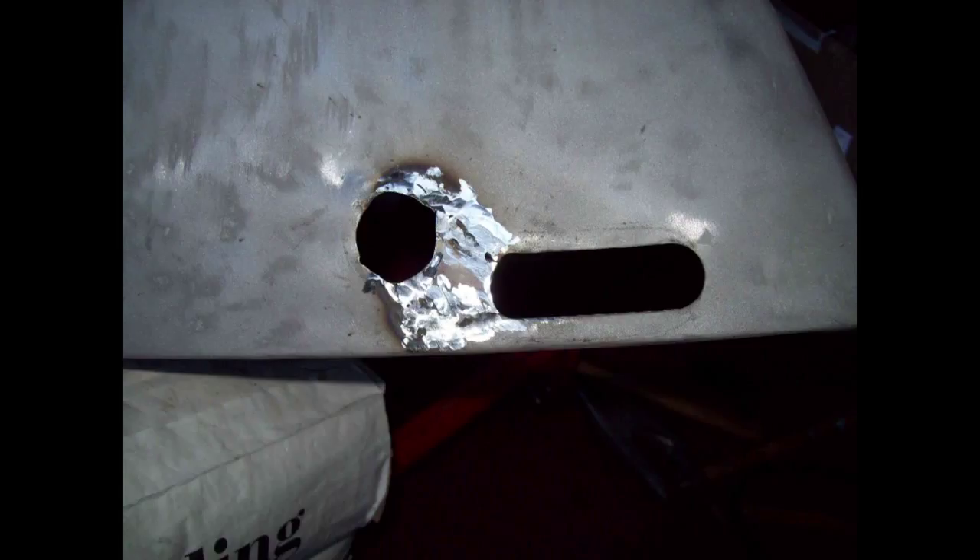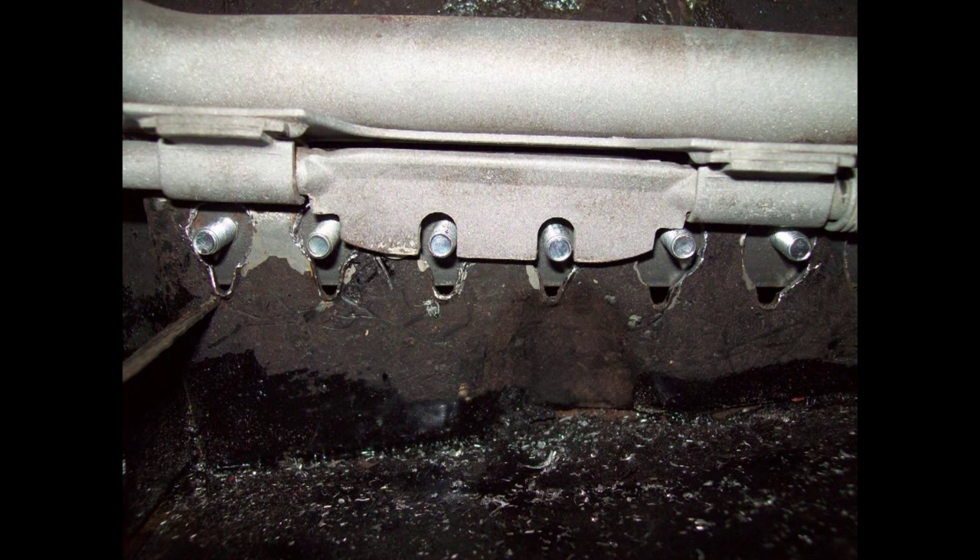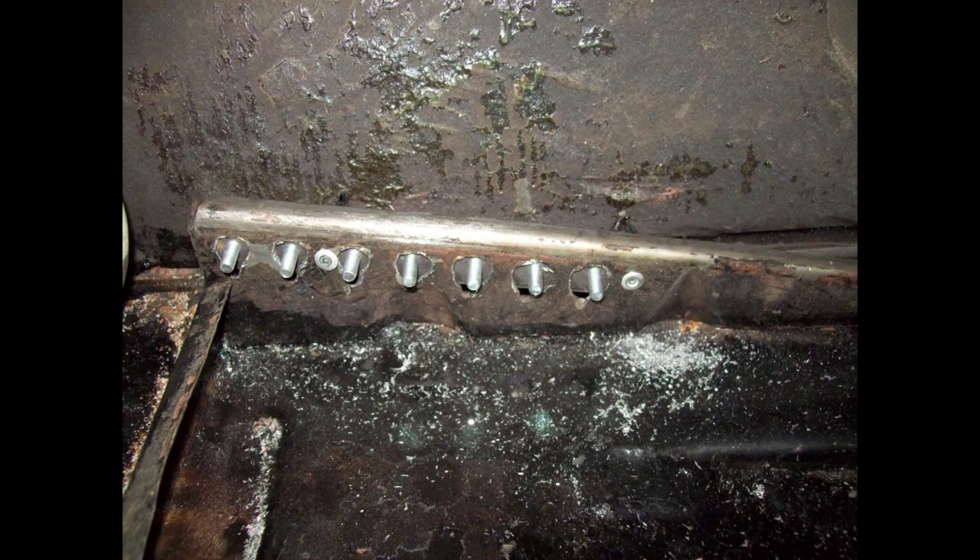This is starting to look better. Be sure your seat adjusters are clean and work freely. My seat locking projections were broken off, and here is the way I repaired that with a plate and screws. If they're spaced properly this works real well, and that plate is pop riveted to the seat frame.